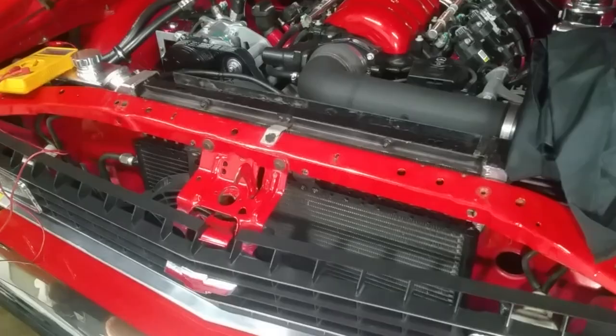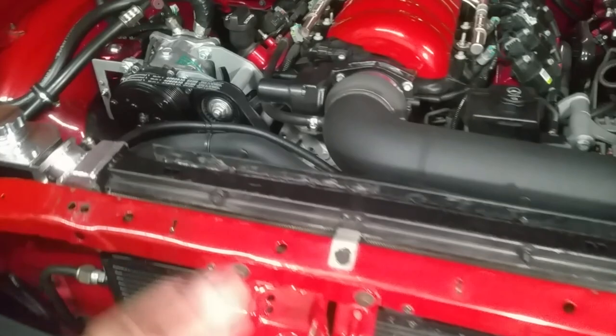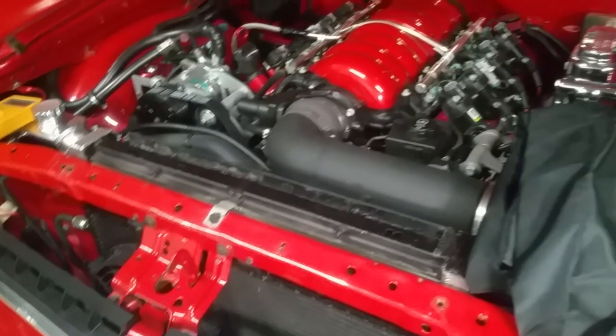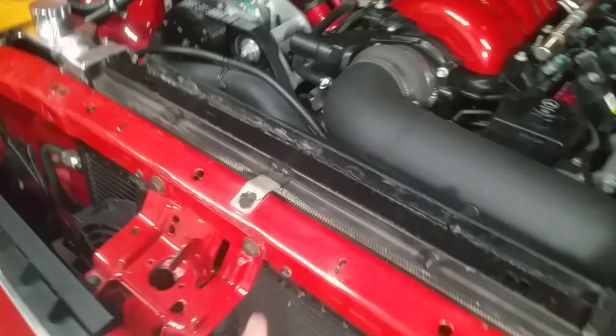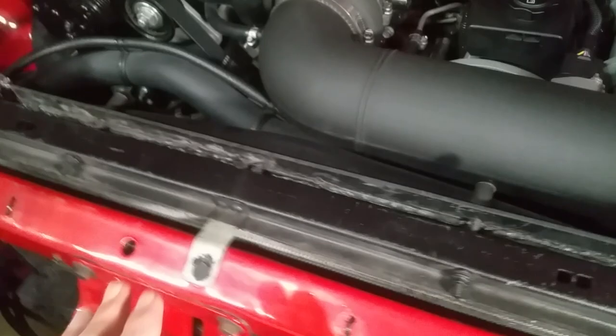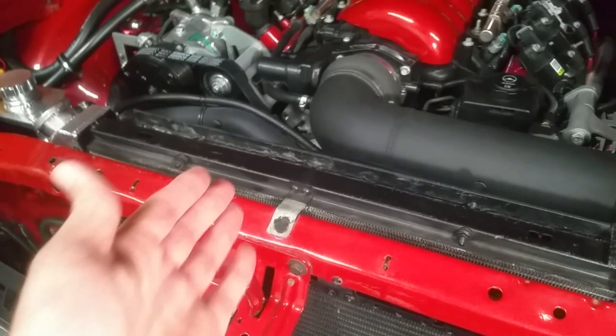The radiator support panel's job is to hold the radiator up against the core support - it had mounting pads on either side and when you bolted it into the core support it held the radiator in place. I never liked that, so one of the changes I had to make was getting the radiator attached directly to the core support. This bracket takes advantage of the champion radiator's raised area - I drilled through it to put mounting screws for the radiator fan and the radiator itself.